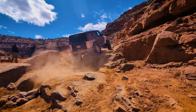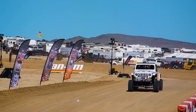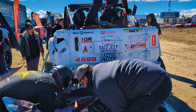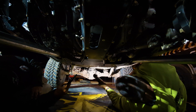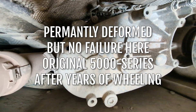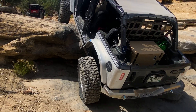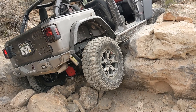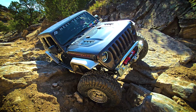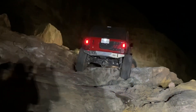Whether you're talking about your daily driver or customer vehicles that have seen some pretty extreme use, or even Ultra4 JLs, you've got to ask yourself: what is the job of a skid plate? If it bends a little bit or gets a dent in it, did it do its job — if it kept the fuel tank safe, the engine safe, the transfer case safe? You have to take the long view. Did the skid bend so far up into the transfer case that it actually rubbed a hole through the T-case? I'd consider that a failure. This JL, even with our previous generation of skids, has gone through some nine-rated trails, and those skids always did their job — but the new skids are better in almost every way.